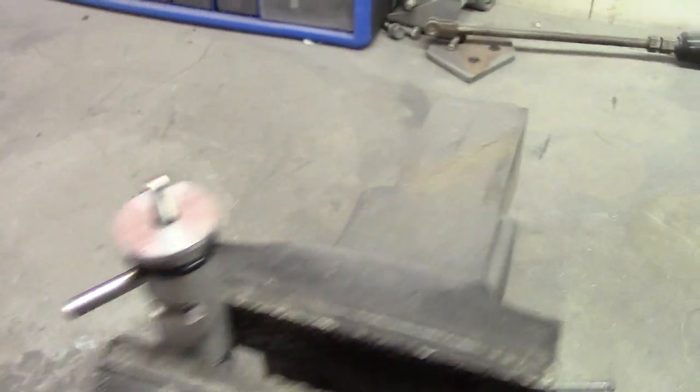On Tim's truck you can see right in there where his fenders would mount, all in these holes. We're going to use one of those holes - on newer Chevy pickups they have black cable things that hold your tailgate from falling down when you open it, you've all seen them. We're going to grab a set of those, figure out the length, and mount them using his existing fender-mount hole. We'll mount one on each end of his tailgate so when he pulls it down, it holds the tailgate level.